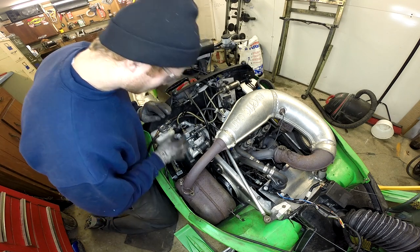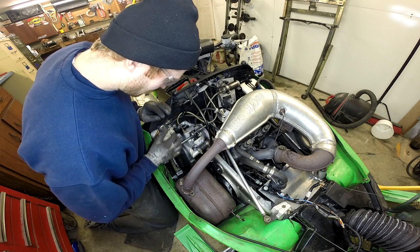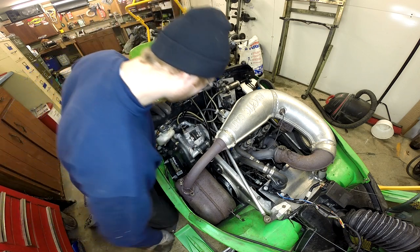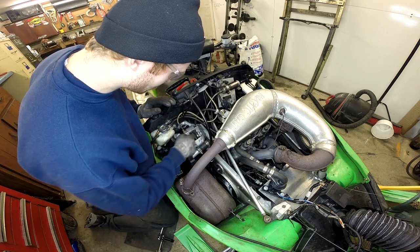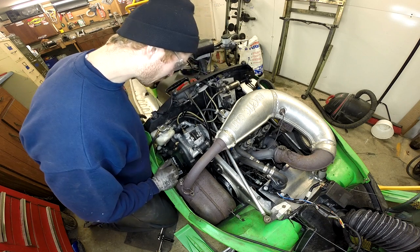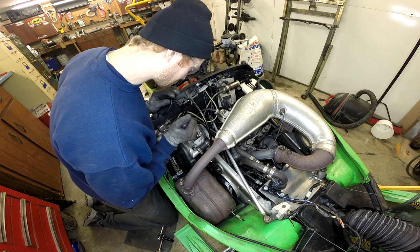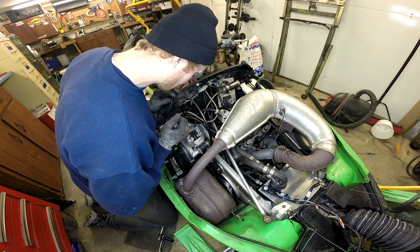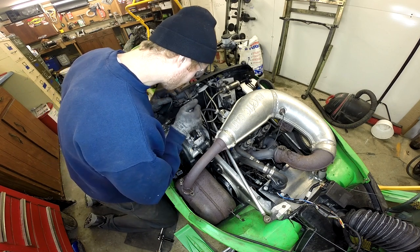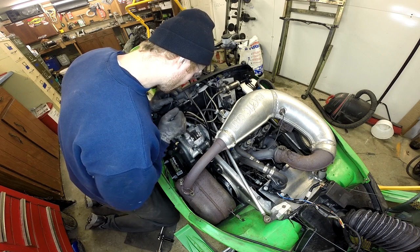Binding up pretty hard on these. I think I'm going to take the line coming from the master cylinder off, drain that out so it doesn't drip everywhere, hang it up, and then with everything opened up start pushing some more. I'm getting some movement — got them moving in. Like I said, you still got to take your time so you don't mess your seals up or bend or break something.